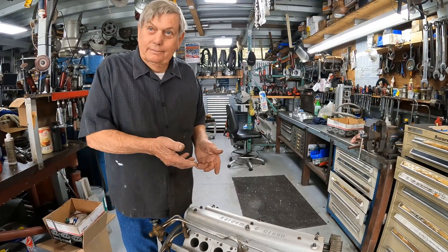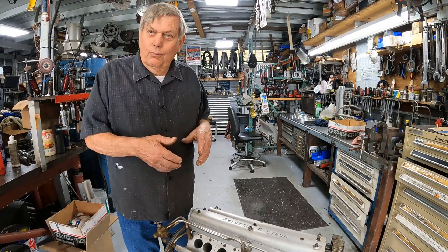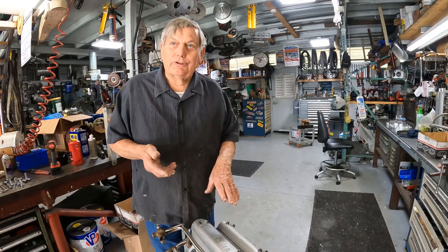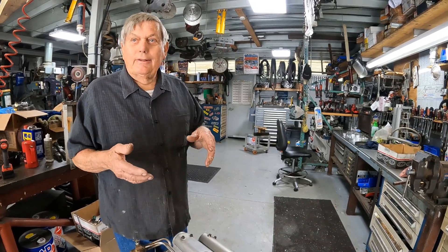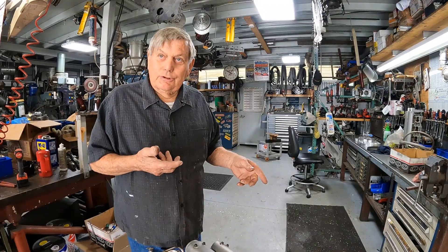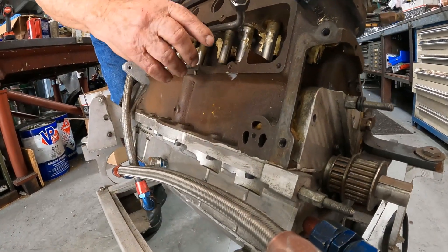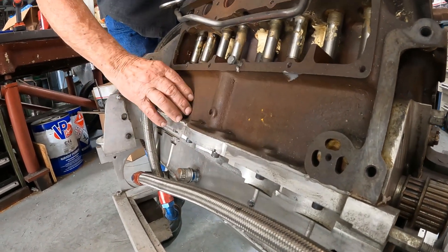So I got the good head — the twin cam, two-and-a-half-liter Subaru head. We bought them brand new, put valves and springs in them, bolted them to the plate, welded them together, put the belt on it — two cams. That was back around 2003-2004. We got the engine running. We bought two four-inch cranks with five mains, a set of rods from Crower, and a set of high-compression pistons — J&E or somebody. We bolted the other two mains in using the lifter holes, going from three to five mains. Then Kevin made the girdle that holds the crank in.